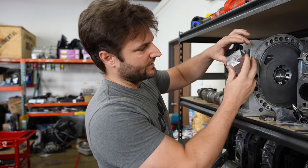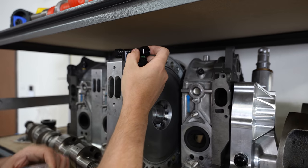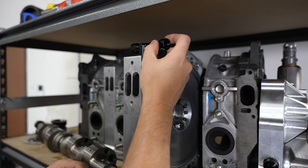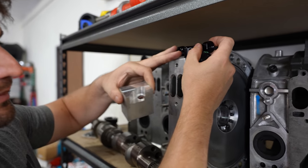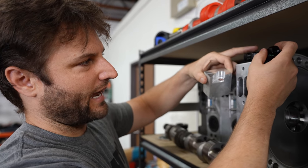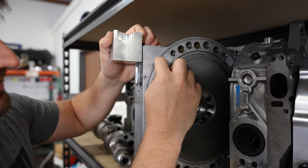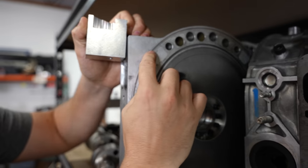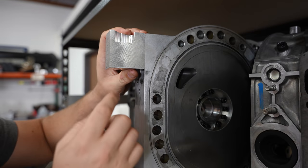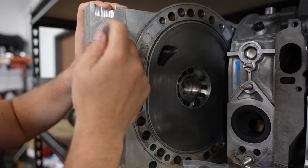So we have machined this as a test. We will graft primary injector rails almost back to stock. These are stock ones from Full Function into this area right here. We have to make sure they don't hit the intake manifold because it does this like boomerang, almost 270-degree whiplash back. So it has to be in the right position. We also can't go so far in that we get close to this coolant seal ring here. You tap into that, game over. Looking at this side by side, this is our current optimal solution.